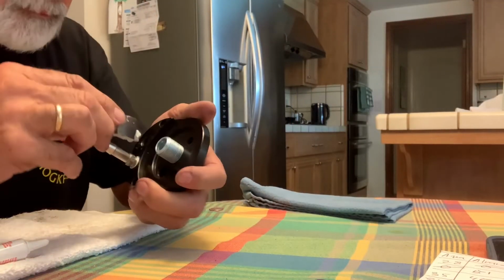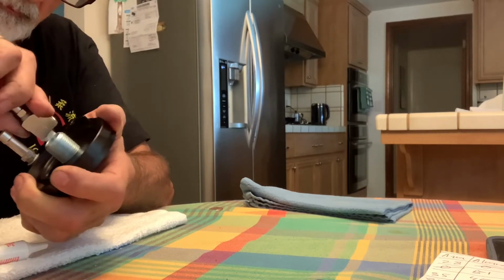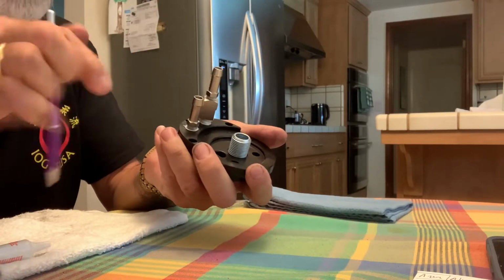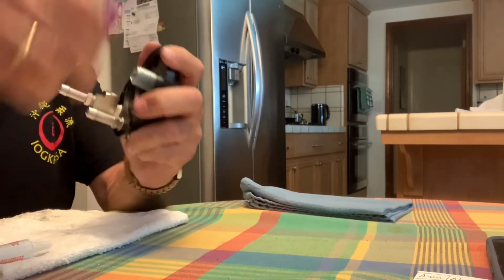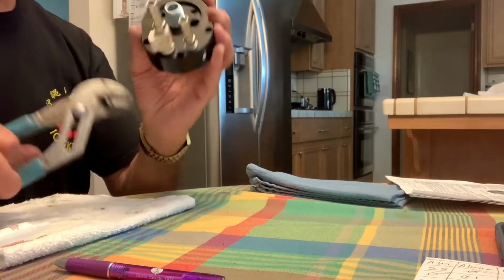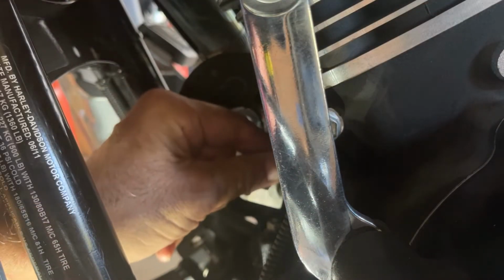After removing the left side push-on fitting with a 7/16 deep well socket, you can go ahead and install the street T pipe fitting, as you can see in the video, and then install the push-on fitting on it. The instructions in the kit are very clear on this process, so I'm probably going to make more of a mess trying to explain it. Installing the anti-rotation device.